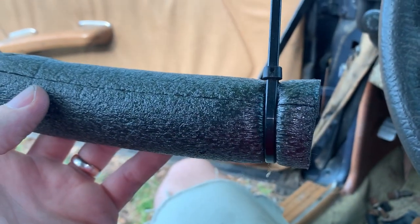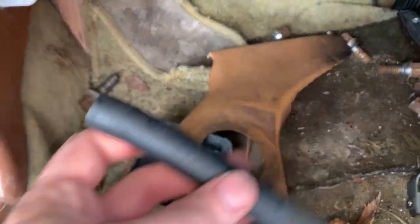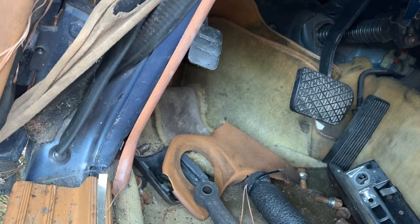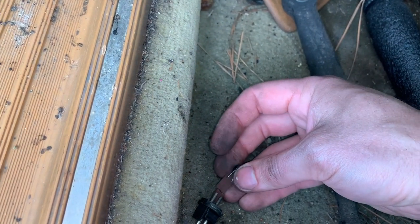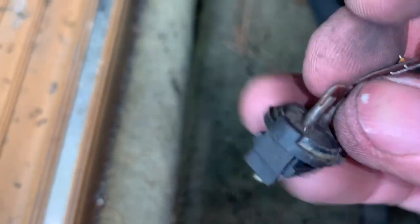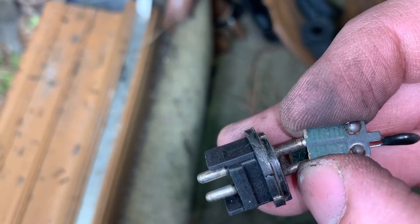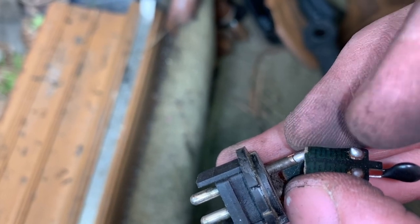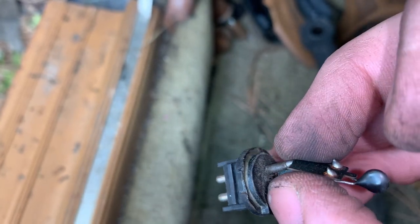For now I'm just going to put that on mine. Mine evidently was working without it so we'll just put it on there and I think it'll be okay — it had just a short tube as well. Here's the sensor off the parts car. We're going to have to piece this back together and solder the connections because those traces are broken. We'll repair the board first and then probably just jumper a wire from there to there on each side to restore the connection — that's probably the easiest way.